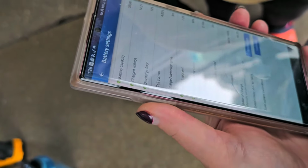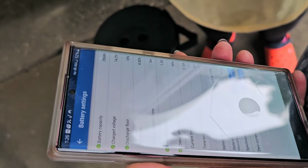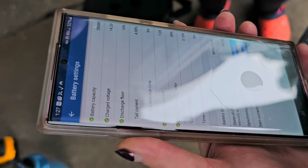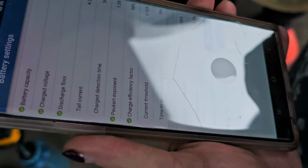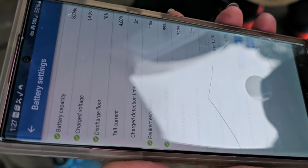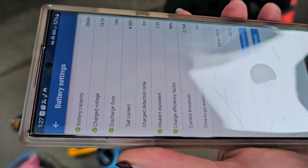Well, that thing up there changes depending on when I was driving. When we stopped last night, it was 14.4 because it was charging. But normally it's 13.7 to 9. Well, yeah, what's going on is lithium batteries, when they bulk charge, they suck amps because they're really hungry, they want to fill up. Right. That's at about 13.6, 13.7 volts.